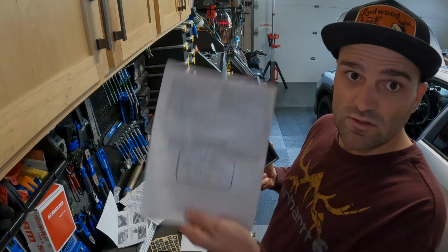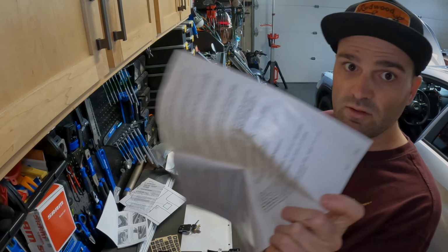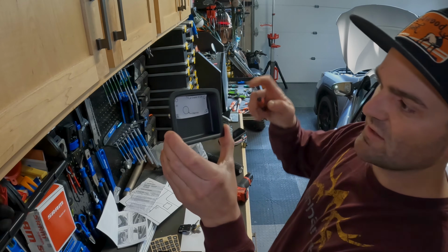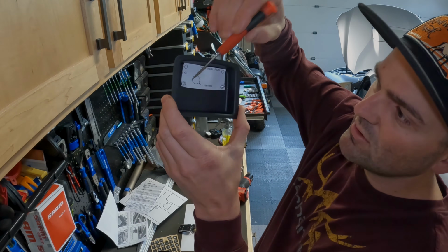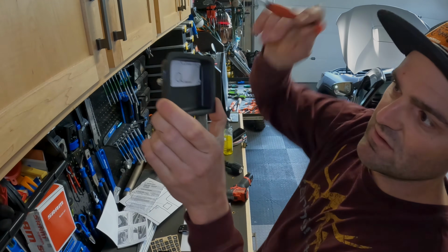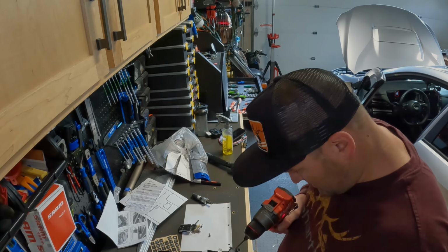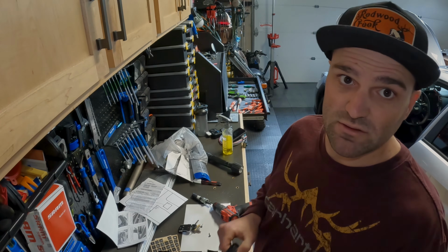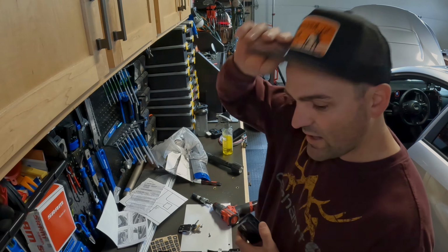So on your Switch Pro instructions, there's this template. They tell you to cut it out, but on the back there's instructions. So I just made a photocopy really quick, cut it out nice and small, ran a couple pieces of the all thread through the back, and then now we're just gonna mark these two top holes. And I know the 1/8 is a little small for the size screw we're gonna be using, but I find anytime I put something in plastic, I just make it a little bit smaller and actually kind of thread it onto the plastic.